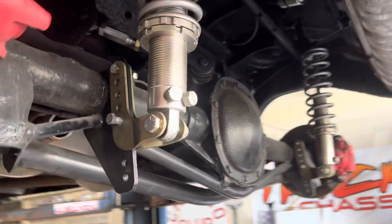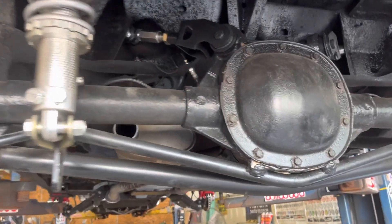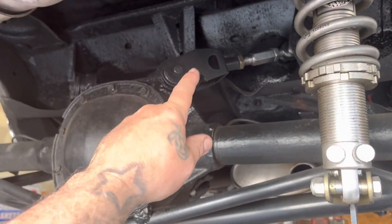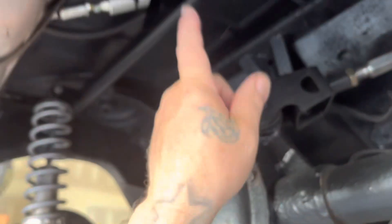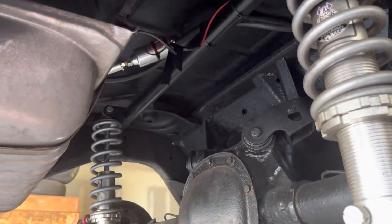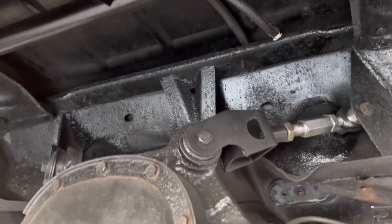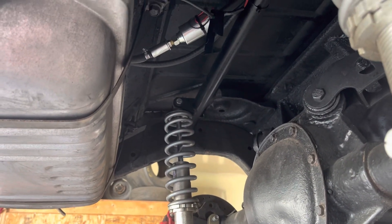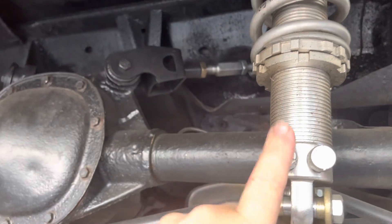I did this car three, three and a half years ago. You can tell things are different if you really pay attention to what I do now versus then. He has new double adjustable uppers - red - new double adjustable lowers - red - and an anti-roll to go in there. The cross members are in there, boom, set up the anti-roll, put the tabs on. I normally put the cross brace towards the back but these are 12s - that's why. I use tens now to keep the distance shorter.